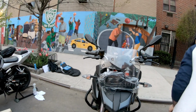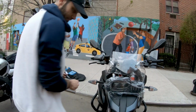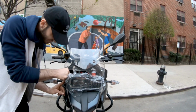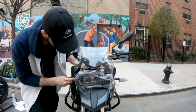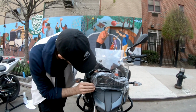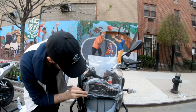Torque specs of the headlights, I think it's about 8 Newton meters or something. They're not overly tight. I'll post the torque specs in the description, but they shouldn't be too tight. Don't go overboard on them. Basically, that's about it for the video. The whole procedure took about 12 to 15 minutes.